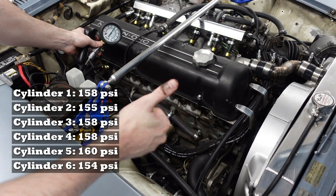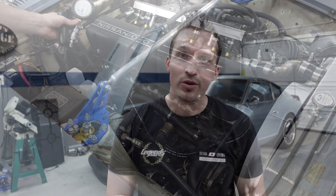Overall, pretty dang good. The compression check is done and all of the cylinders are within a good range — 150 to 160 PSI. That's about average for a motor of this age, at least that's what I've seen online. So that means there's nothing major currently wrong, but there might be some smaller issues or things in the past that maybe are causing smoking now. I don't get a lot of smoke, but it's still good to know these things.